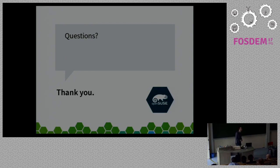Yes, Owen. Is it possible to expose more than one disk? So the question was whether more than one image could be exposed. Yes. At this stage, you saw the config file. It's not really set up to handle that, but it would be easily doable, so you could expose multiple images. The question is then whether the host supports multiple LUNs, or whether, say, your stereo or television can then access, say, LUN 1 or something aside from the default or the first.